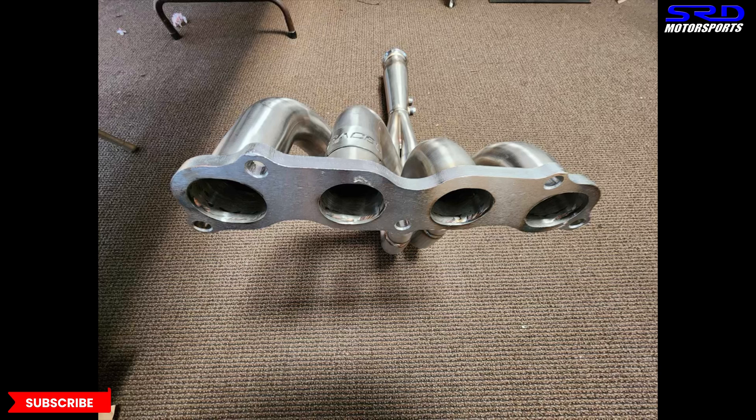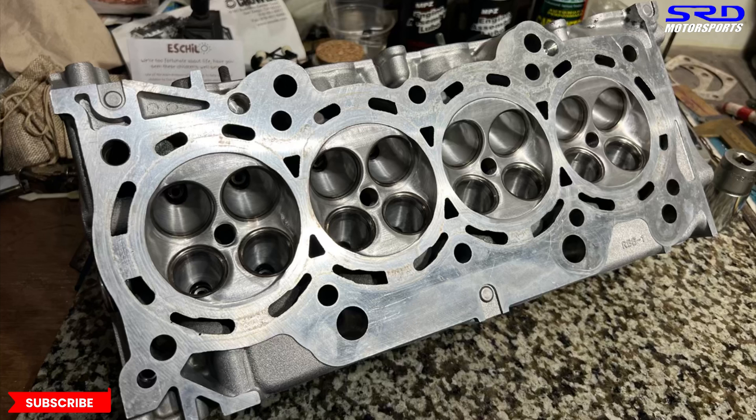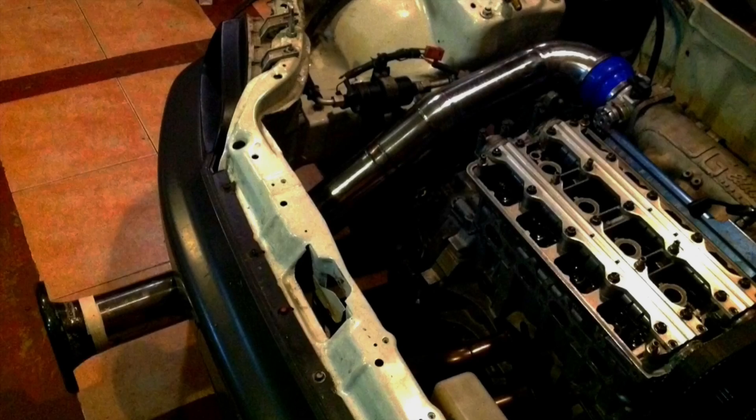The header is locally fabricated in California. The piston compression is 13.5:1 and they've moved up to an 88mm bore. They're hoping to reach 300 horsepower, which I know they can reach with a proper head like this. Once we get the valves installed, we'll have more updates, and when they reach the goal we'll post it on the page.